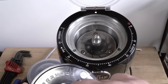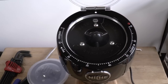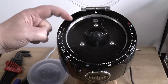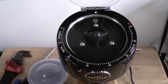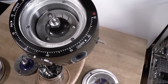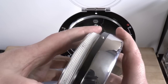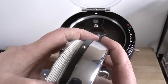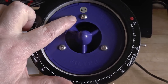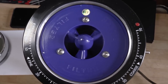You simply rotate the carrier 120 degrees and then tighten the collar until the burrs just begin to touch. The farther you can tighten the collar before they touch, the more parallel they are — so you're looking for the carrier orientation that lets you tighten the collar the farthest. Calibrating, or zeroing, the grinder is easy too. You adjust the thin calibration ring by loosening the set screw, and aligning the numbered scale with zero at the point where the burrs just begin to touch. Niche recommends calibrating only with the espresso burrs installed; however, there's no reason why you can't rotate the upper carrier and find its best position and mark that with a sticker just as you would with the espresso pair.